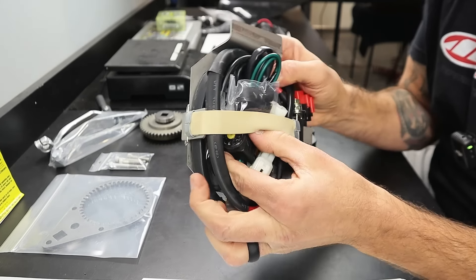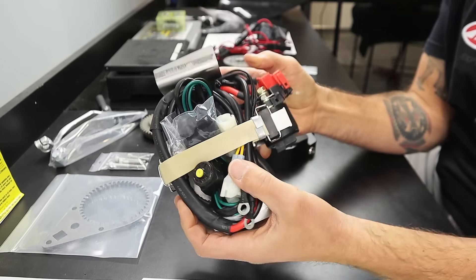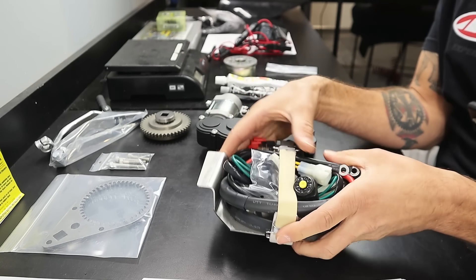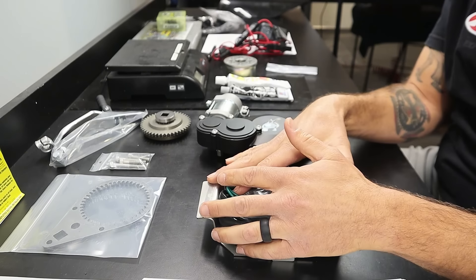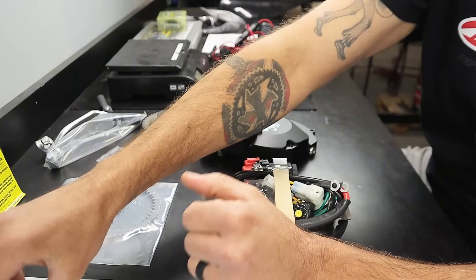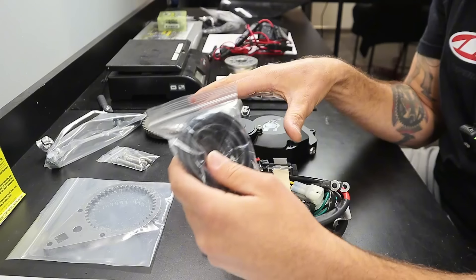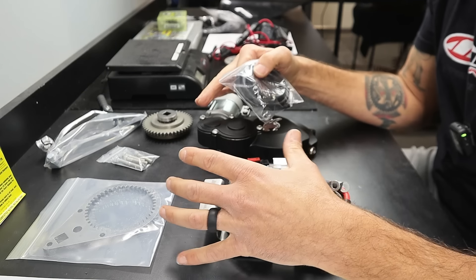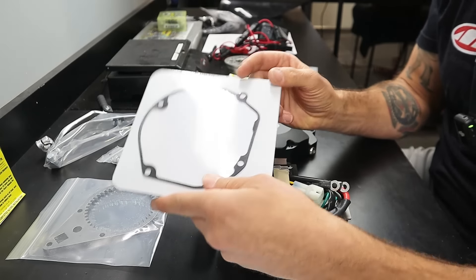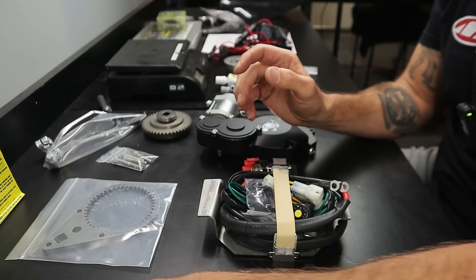You get your battery tray, your magic button — it's even yellow and black, so that works really well on this build. You've got your starter relay, fuses, everything you need to get this kit working, basically up inside the airbox — you'll see where that goes soon. The kit comes with a special tool to affix the gear. There's a vent hose that's going to be a breather because the left side is actually going to be oil-bathed now. Normally the left side of a two-stroke engine is a dry side — that's why I mentioned crank seals earlier. We also have a new gasket.